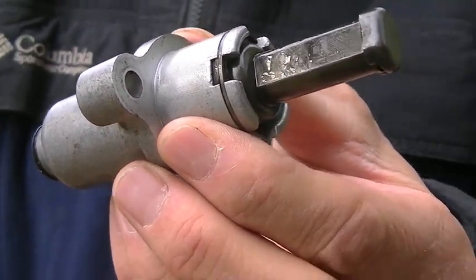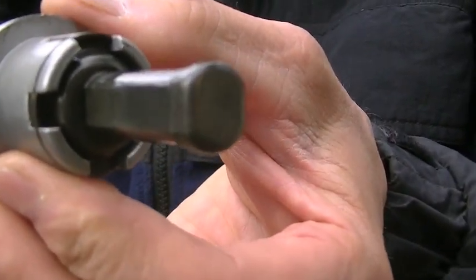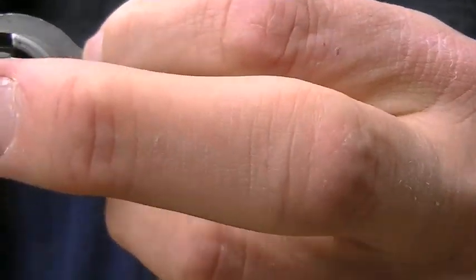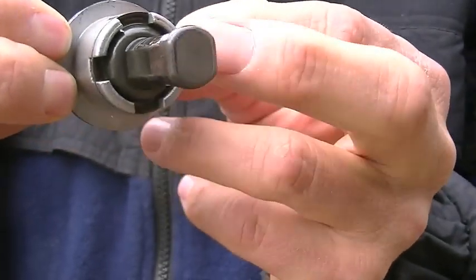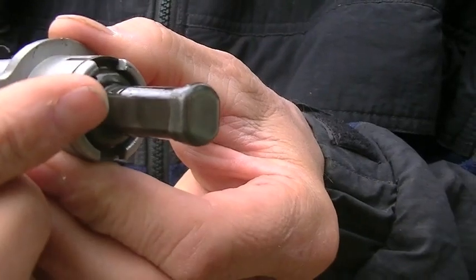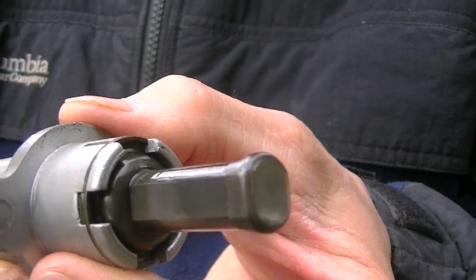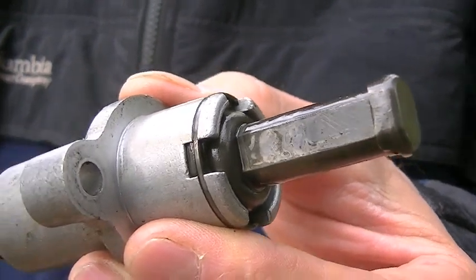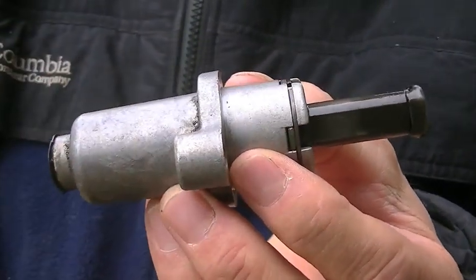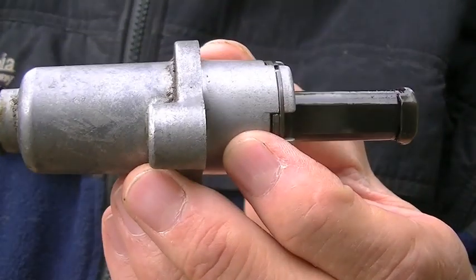The way you can screw this up is if you try to put this into the housing without it withdrawn, and then you bolt it down. This thing is fixed — it can only go one way. The only way you can draw it back is with this screw. So if you have it completely protruded up against the chain and then bolt it down, you can break the cam chain. Understanding that makes it much easier to proceed with the initial extraction from the motor.